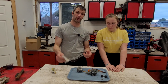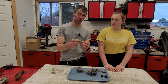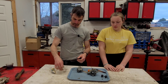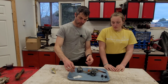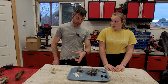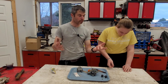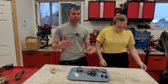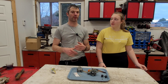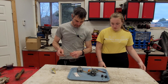We also found out that the starting point is one and a half turns out for the air screw on this particular model — and that's actually the same for most quads and bikes out there. One and a half turns is a really good place to start. We'll have to tune that after anyway, but that's how we're going to get going. Let's open up the package and get the parts out.